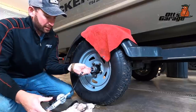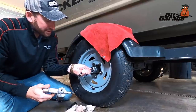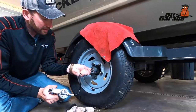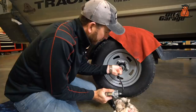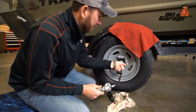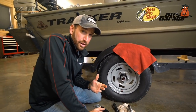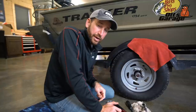It's always good to hold one hand on there, and with the other hand work the handle on that grease gun. If you give it five or six good squeezes of grease, that should be plenty. After just a couple of squeezes, if you start seeing grease come out around the edges, you're good. Five or six good squeezes — that amount of grease is going to stay in there a long time and give you plenty of miles of service. Do that every three to six months and those wheel bearings will last you a long time.